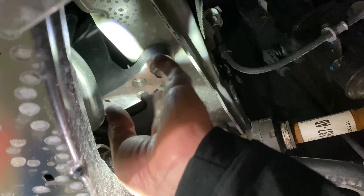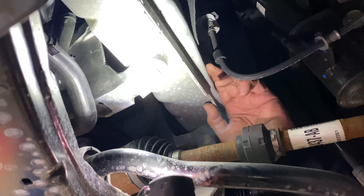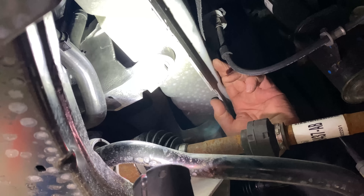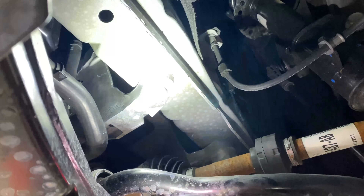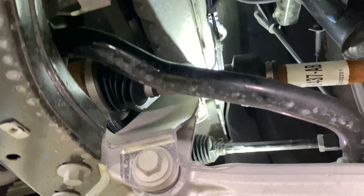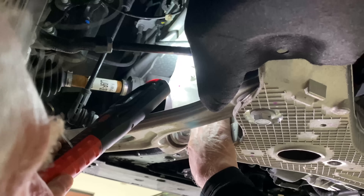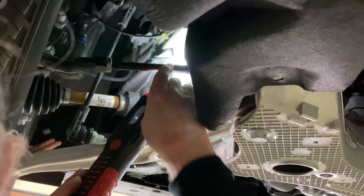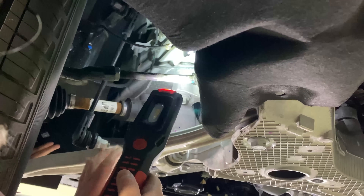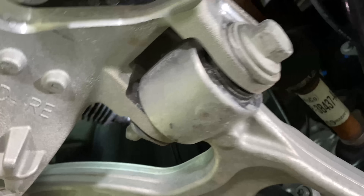Let's have a look at another little feature I think is impressive. The longitudinal goes from one end of the car to the other and basically acts like a frame. Normally we'd see one bolt here holding the cradle in place. But over here, look at this bolt — it's holding up the motor, then going through the cradle and popping up into the longitudinal. That's really good engineering. I'm so impressed with what Ford is putting out on this car.